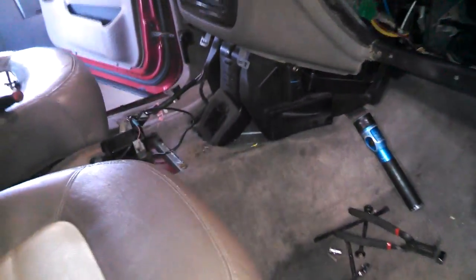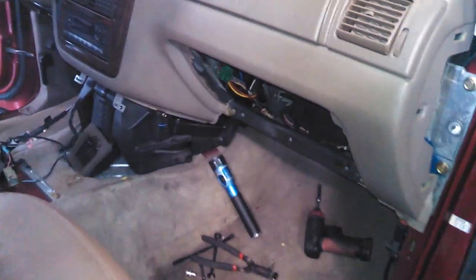That was the first time for me to try it, so I was taking maybe more apart than I needed to. So, get to work underneath here. Take this side shield off, like I did. Two 13 millimeter bolts here. 10 millimeter bolt bracket here. That's probably pretty important though, I think, for getting the dash to move at all. Which I think it did need to move a little bit.